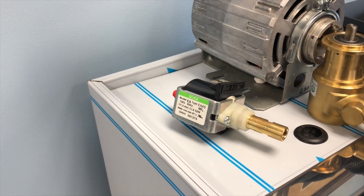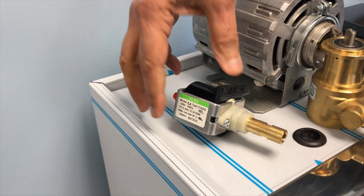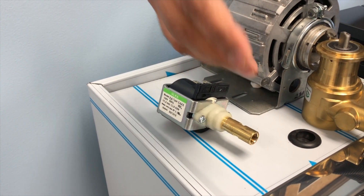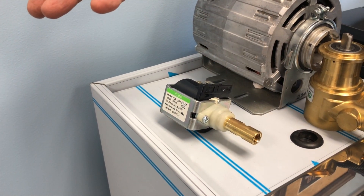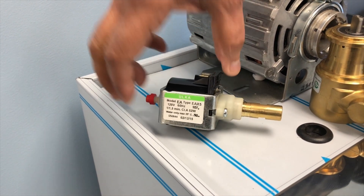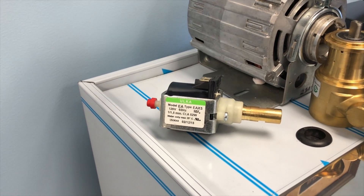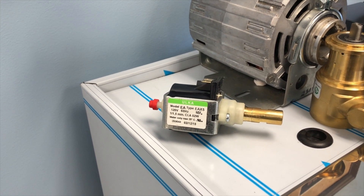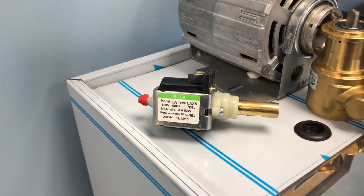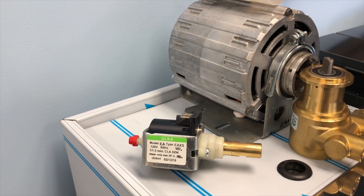This pump has a pressure regulating device that you can increase or decrease the pressure, but that is normally not required because it has an overpressure bleeding nozzle on the side. So if the pressure is too much and the water is not going towards the boiler to make espresso, it will bleed that excess pressure back into the water tank. It is a very safe device. It is very small and, yes, it is vibrating — but that vibration is not like a fire brigade passing on the road where you cannot even hear each other talking. It is just an exaggerated statement that the vibrating pump is very noisy. It exerts as much noise as the motor that works to operate the rotary pump.